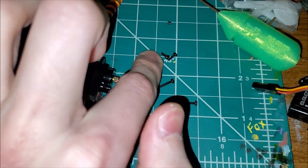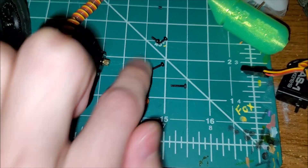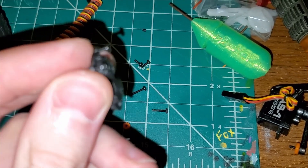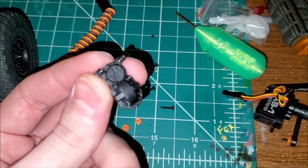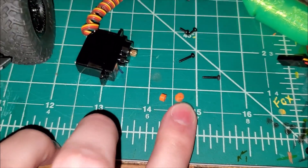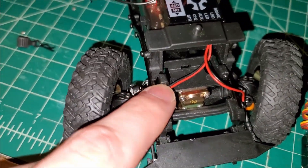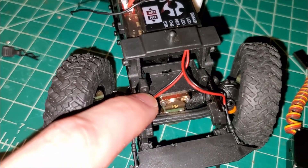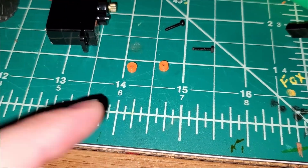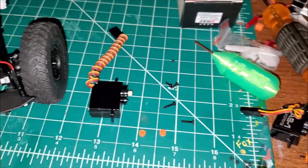These are the screws that came out of the old servo when I was mounting it. These are the screws that came out of the old differential cover — there are the bottom two screws, the top ones were longer. I used the bottom two because they were longer than those original ones. And then I just 3D printed these itty-bitty little spacers to take up the slack between the wing here and the side of where the screws go in. I didn't want it stressing straight on the threads, so I made a spacer — it's 2.5 millimeters tall, 4 millimeters wide, with a 1.5 millimeter hole. I'll put the file in the description if anyone needs it.